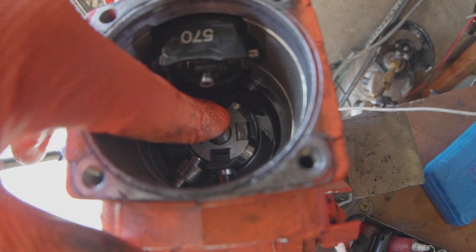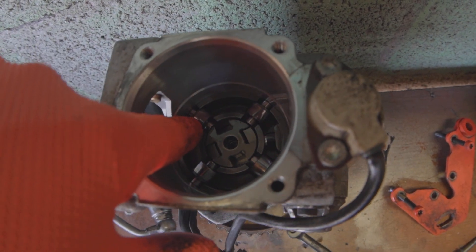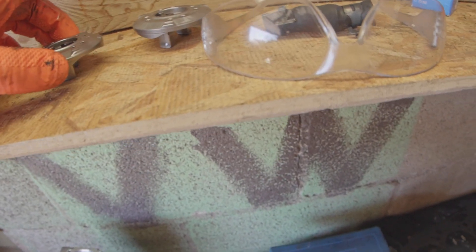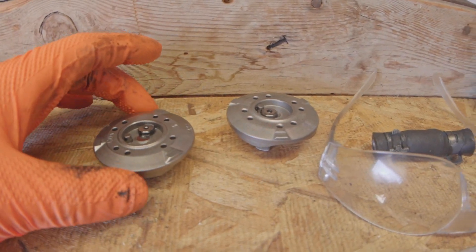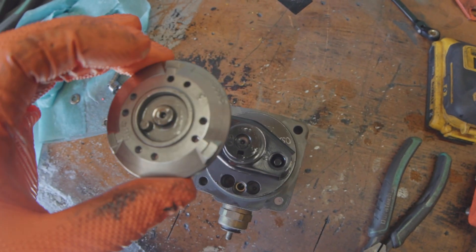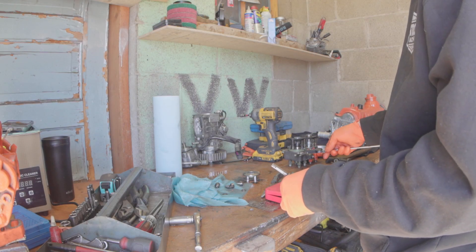Comparing differences: there's a spring underneath the cam plate in the 1.6, and in the 1.9 there is no spring and no place for one. The rollers are also slightly different - the 1.9 has a kind of one-piece roller on the inner spindle and the 1.6 has two-piece rollers. These cam plates should both be about the same since they're both allegedly 1.9 cam plates. Most important of all, you've got to get that tooth lined up with that tooth, and you can't forget this little washer - if you forget the washer, the car doesn't work.